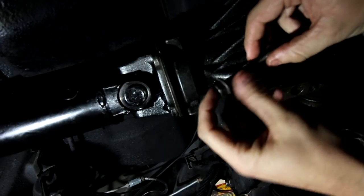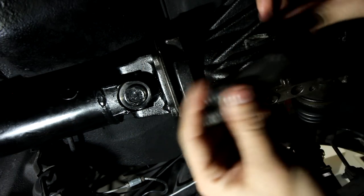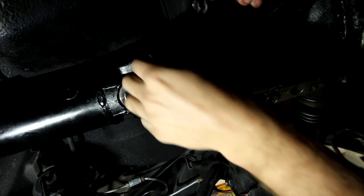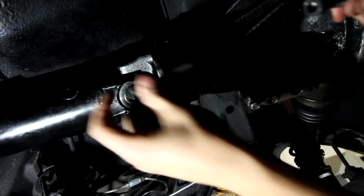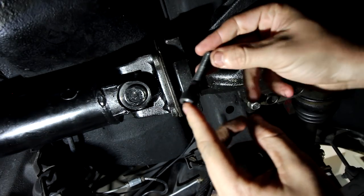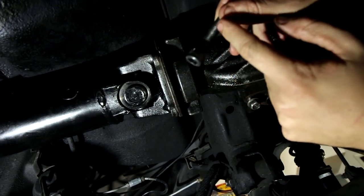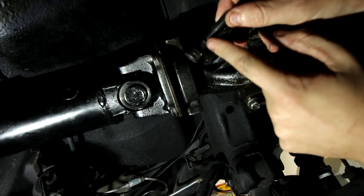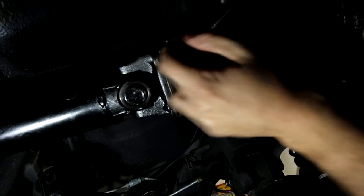And right now I'm trying to figure out what size and length bolts I need to get for the new driveshaft bolts, since I don't have the ones I used, and the ones I had before were really crappy. So I'm just trying to get an idea of diameter, thickness, or different types of bolts. When you do driveshaft bolts, you want threads where you thread the nut onto, but no threads where the bolt goes through the driveshaft and the diff.